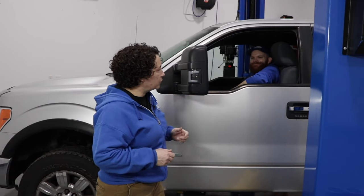So I'm going to have Lenny give me a hand, because you want somebody up in the vehicle so they can put it in four-wheel drive, and you can check for vacuum and make sure that actuator's clicking in and out. Let's go.